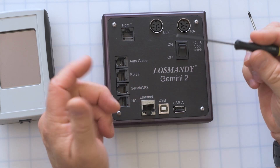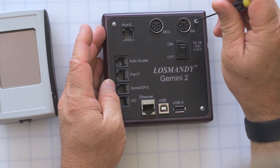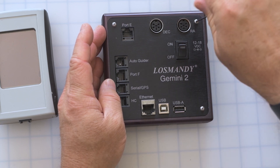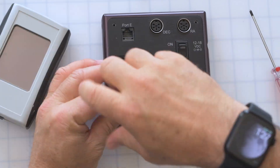It's actually very straightforward. There's a lot of misinformation — I think it's from older videos and approaches — but for the Gemini 2 Mini this is the easy way you do it. First you have your hex wrench; I'm going to put the size in the description. We're going to remove the four screws on each corner. You want to make sure the thing is powered off and not plugged into any sort of power — should have mentioned that before.